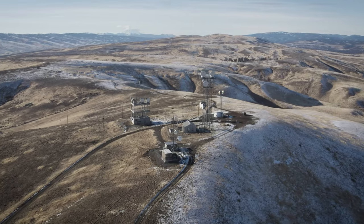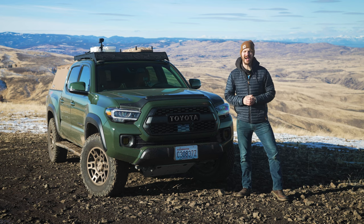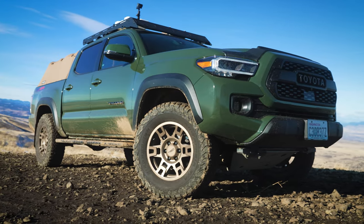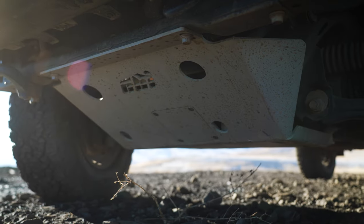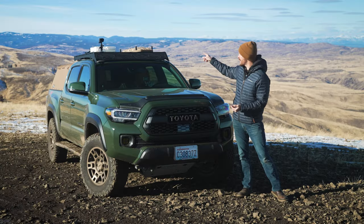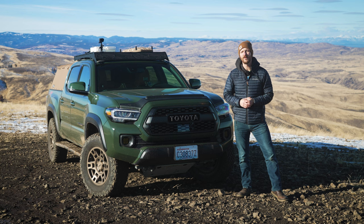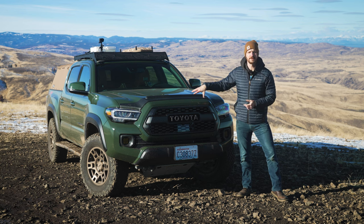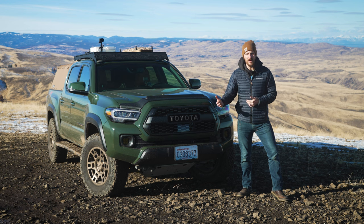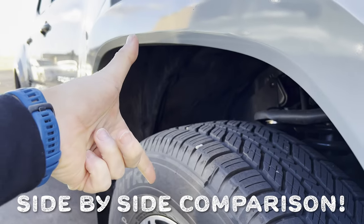We made it to the top of Autanum Ridge — we've got views of Mount Rainier and Mount Adams. Now my slightly negative warning to you guys isn't just about the skid plates, it's about armor upgrades in general. In the short time I've owned Sarge, we've upgraded the skid plates, added the CBI Overland sliders which are kind of heavy — I believe they're 150 pounds — and added a Prinsu rack with gear I run up there pretty much all the time. With all those things combined, I think we've reached a tipping point where the front suspension has now begun to sag, probably around an inch. That's negative not just for looks, but because that front skid plate is now getting much more of a workout than it should.